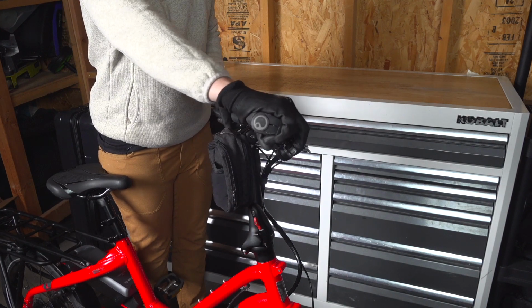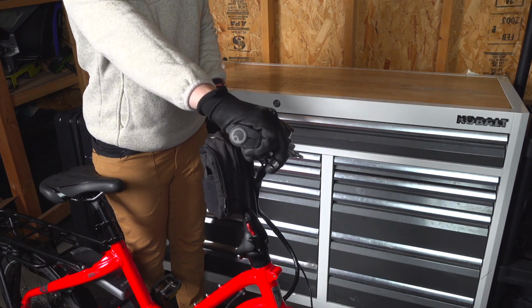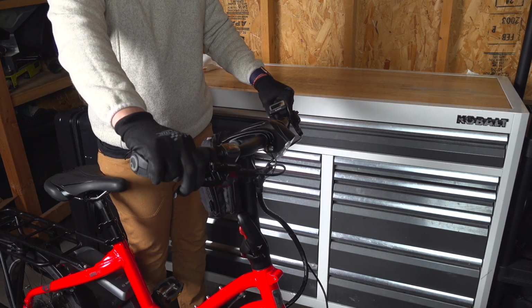If your brake levers come back to the handlebars, or it's pretty easy to push your bike forward with that one brake squeezed, you really should visit a bike shop before riding. It could be your brake pads are low, or maybe if you have cables or a hydraulic system, something is not going right. So don't overlook this step. If your brakes feel funny and they don't stop you properly, don't go riding and visit your bike shop.